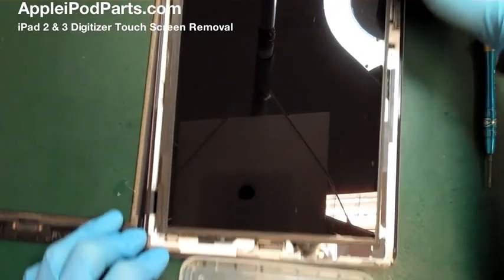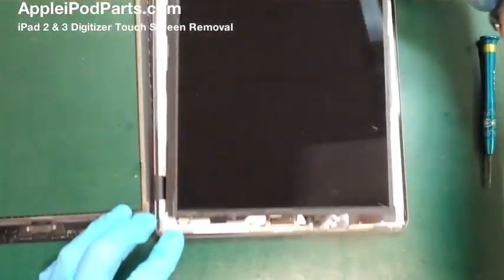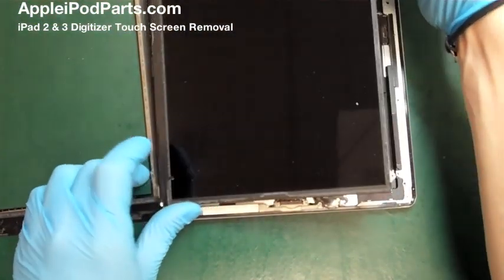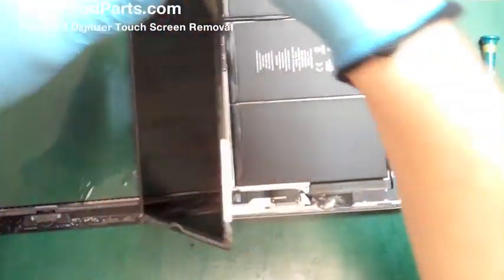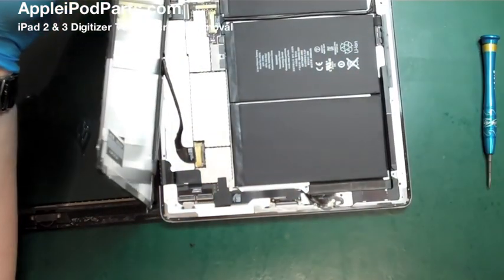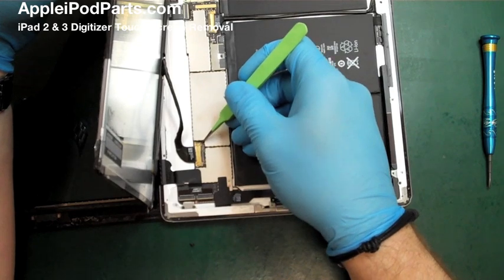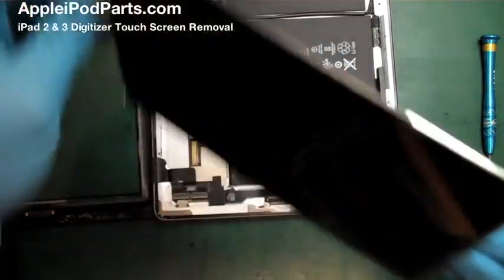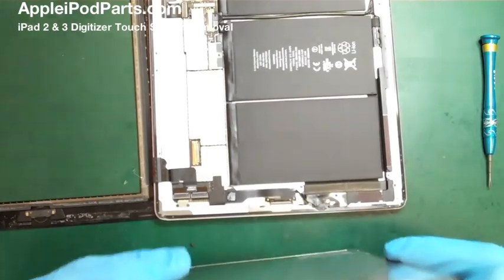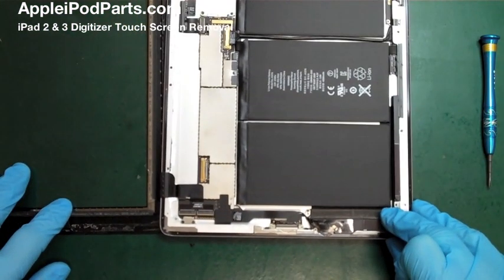At the top corner — you can see where my finger is — you can just get in there and gently pull the screen out. If there's any resistance it's going to be stuck, so give it a bit of a wiggle but don't damage the screen. Give that a bit of a shake to get rid of glass shards, and what you're left with below is the gold clip for the LCD connector with a little bar going all around. Use tweezers to lift the bar and pull the connector out, then move the LCD to one side.